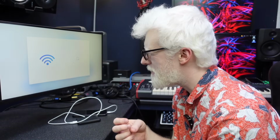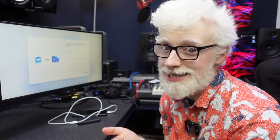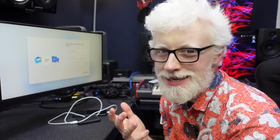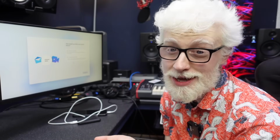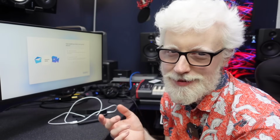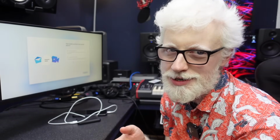The thing is, I'm currently using my gaming PC every evening at the moment, pretty much. And the thought of tearing it apart is kind of soul destroying. Because what I need to do is get this RX 580 in a known good system to see if that's good. The trouble is, I will need to nuke all my display drivers on that system. That system works perfectly. I'll need to get this GPU in and then test it, make sure it actually runs properly, see if I can install the drivers. I just don't want to mess with that other system because it's been so fantastic.